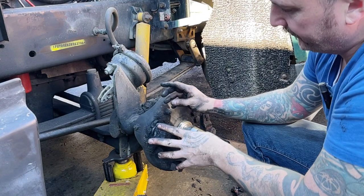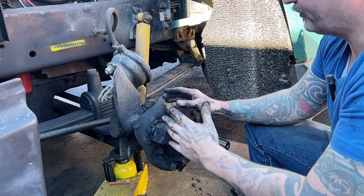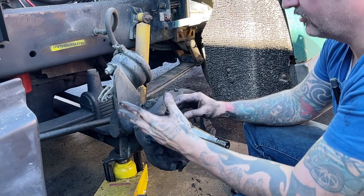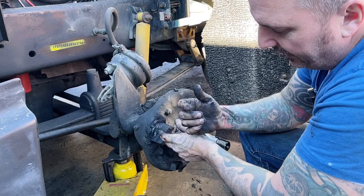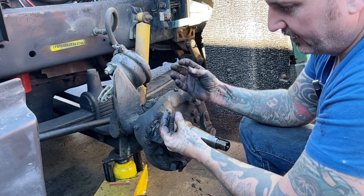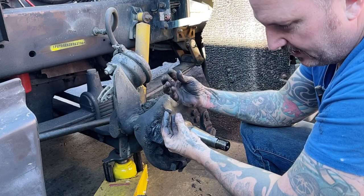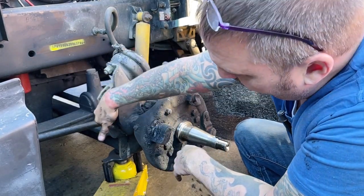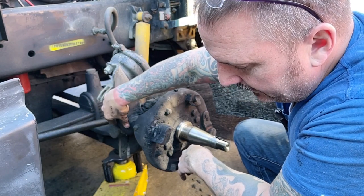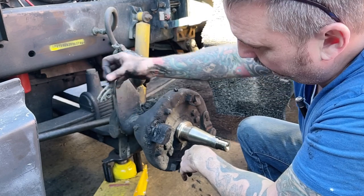because you know, when you're greasing a wheel bearing, a spindle nut, whatever on your trailer, a tie rod end, whatever you're greasing, when you're pumping that grease in, the object is to pump fresh grease in and expel the old dirty grease. And usually there's a place for it to expel. And on an S-cam, it's supposed to expel out here between the S-cam housing and the slack adjuster.